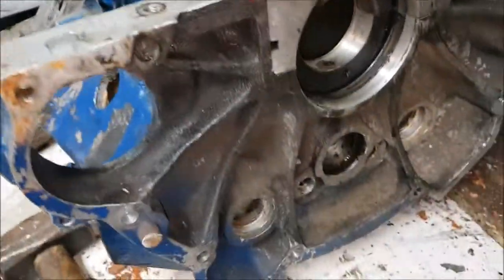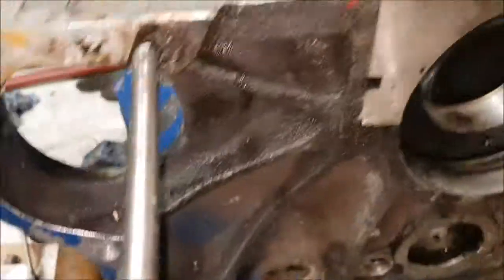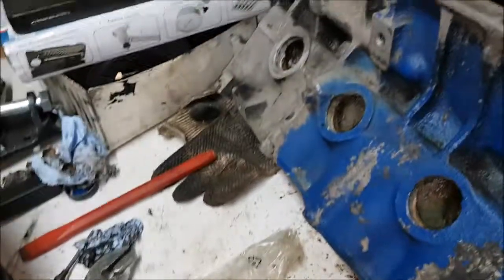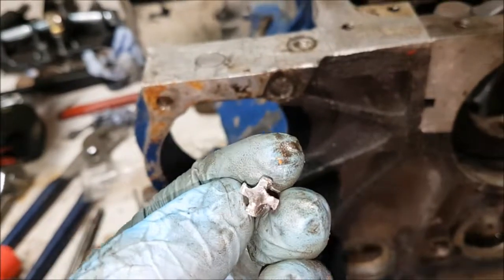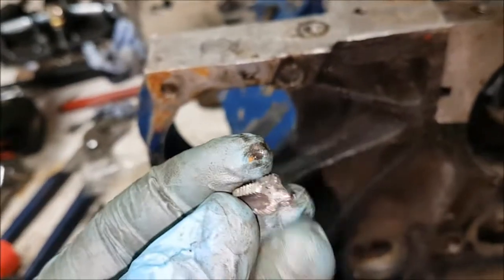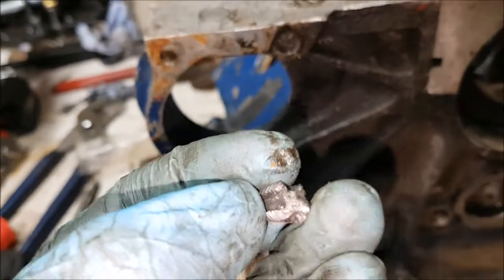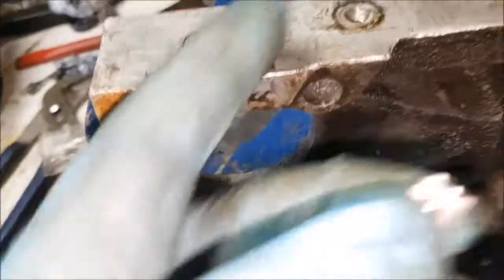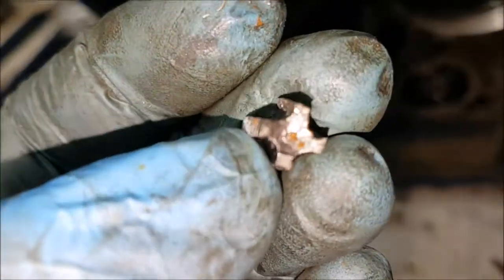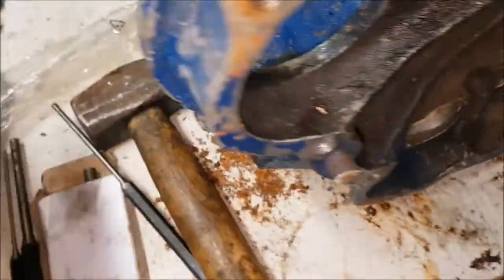The block is pretty much now ready for the engineers. I found out what was blocking that hole up - when I was trying to put it onto my engine stand it wouldn't go in. I found the end of someone's tap broken off in there. These things, when they break off in holes, are an utter bastard to get out. I was able to see when drilling that it was the thin end, so tapping from the back with a couple of sharp taps and it flew out. Once these things are in, often they are an absolute swine to remove.